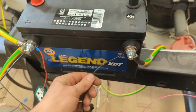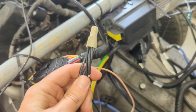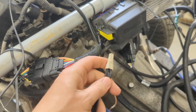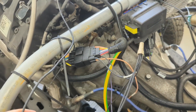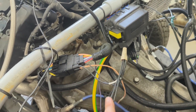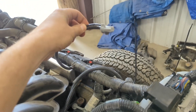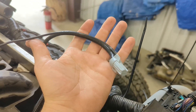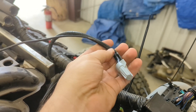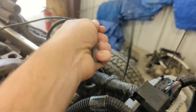There's also a number 12 scrap wire that comes up to this wire nut. This whole wire nut is like the ground for the control side of this setup. One ground comes in, then ground goes out, comes along this wire, goes over here — and this would have been one of the main harness grounds for the truck, probably mounted to the firewall somewhere in the cowling area. There was a little eyelet that was all screwed up when it got removed from the truck, so I just cut that off and grounded it right there.